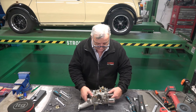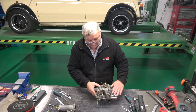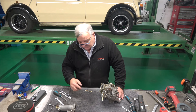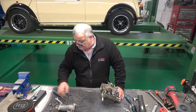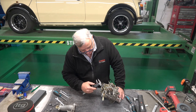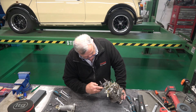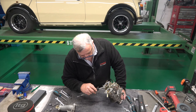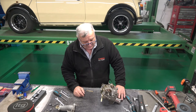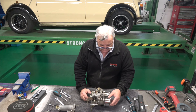So I've taken off the inlet manifold here. Everything seems okay. The 40, 45, 50 — whatever the size is — is actually the butterfly opening or orifice size. So if I measure this now in millimeters, that should be 44.86. So there — 45. The only thing I can see is that it's a bit loose, so there's something happening there with the gasket.